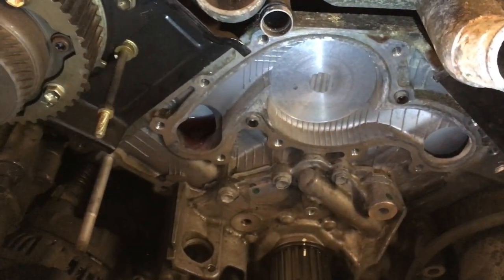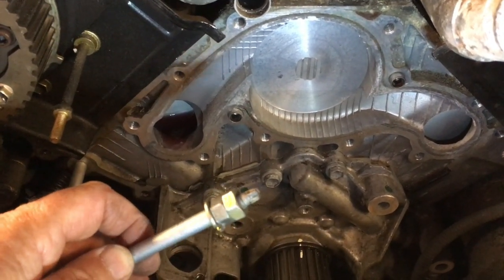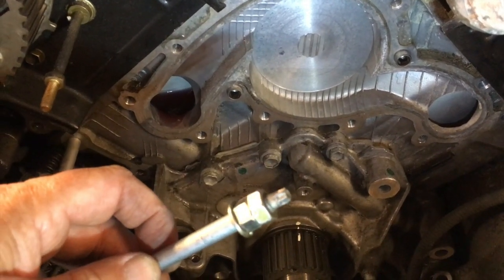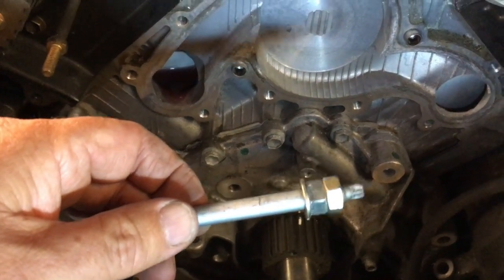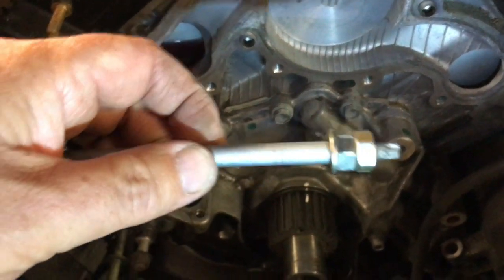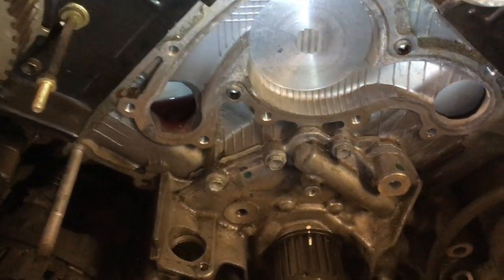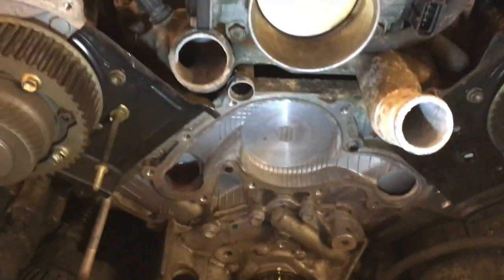Now with the studs, I think there is a Torx socket end for it, but it's quite big and quite thin, the Torx thing, so I would put a couple of nuts on it, which is what I did. I lock them together and then move the stud out that way, because it's just safer rather than breaking the end off. So that's the water pump.